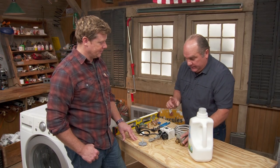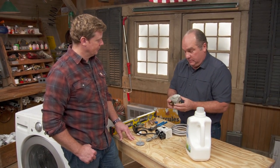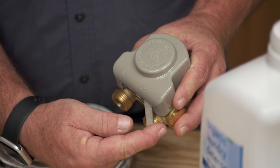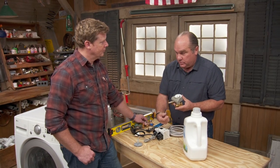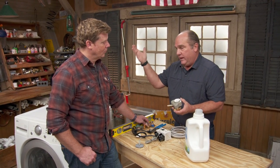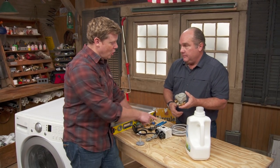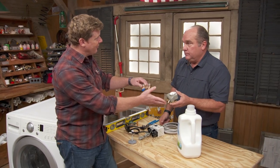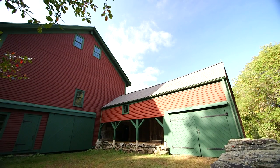There's also a simple spring-loaded lever device. You come over and pull it to the side, which leaves water pressure to the hoses for two and a half hours. When you're done you don't have to wait — you know the wash will be done and it'll shut off. No electronics to fail, and unlike the other option it defaults to the off position, so you have to actively do something to allow water flow. It's fail-safe — I like this a lot.